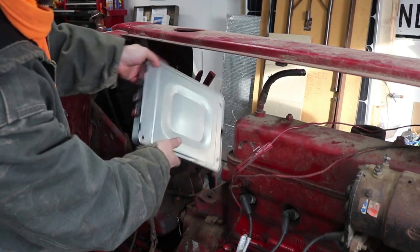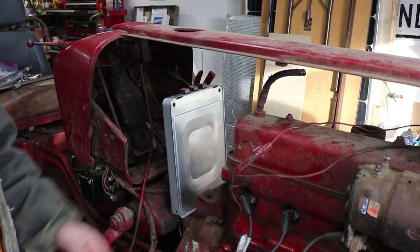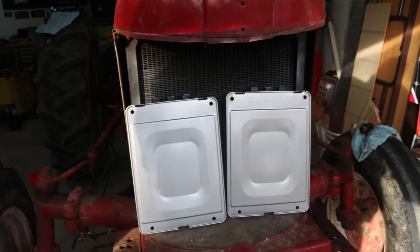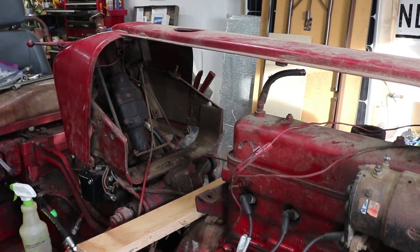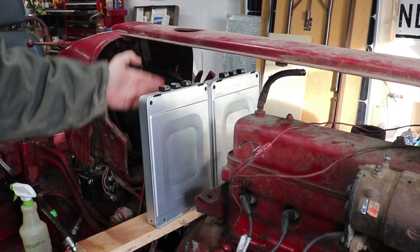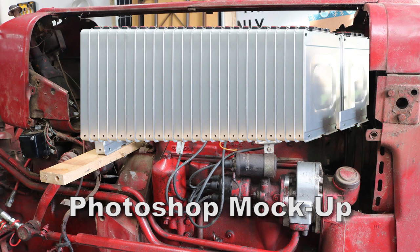The other thing I was wondering is: what if I tipped this up? Well, that certainly fits, and it's relatively narrow — I've got extra room on both sides. In the front, the radiator is about 18 inches wide, and this is only 9 inches wide. So I thought, could I double them up? Could I do twice the width here? Let's put a little spacer in and grab another battery. It looks like I do have room for two batteries wide, with enough height, going about 32 inches across — and that's an entire Nissan Leaf battery pack. I could fit 24 kilowatt hours in there from a junkyard battery pack.